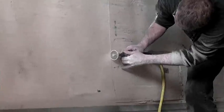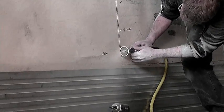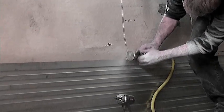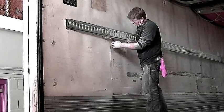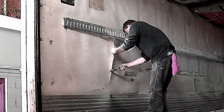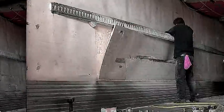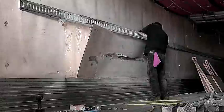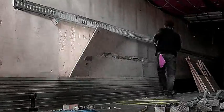Follow the line that you scribed earlier for your side cuts. Make sure that you cut the fiberglass under the E-track area about three quarters to the top of the E-track space. This will allow for the new panel to slide up underneath the wall. After making all of the cuts, use a small pry bar to gently pull the fiberglass away from the foam. If you are careful at this stage, you will not pull a lot of foam from the wall. Another option is to use a drywall taping knife to strip the fiberglass away without damaging the foam.